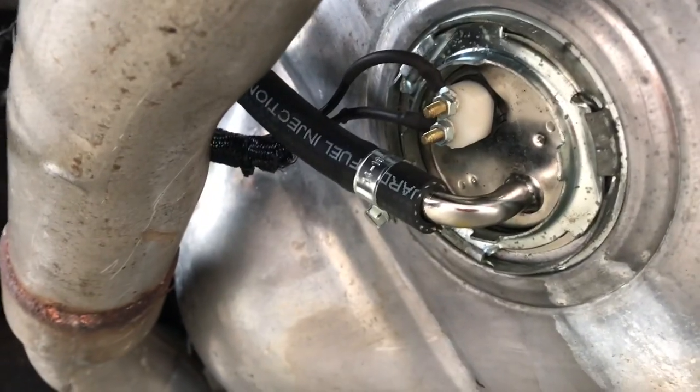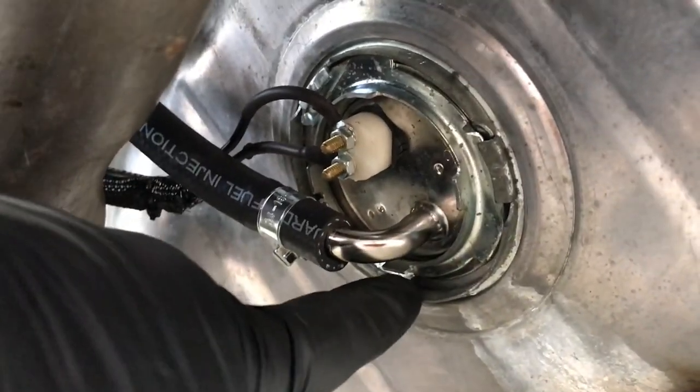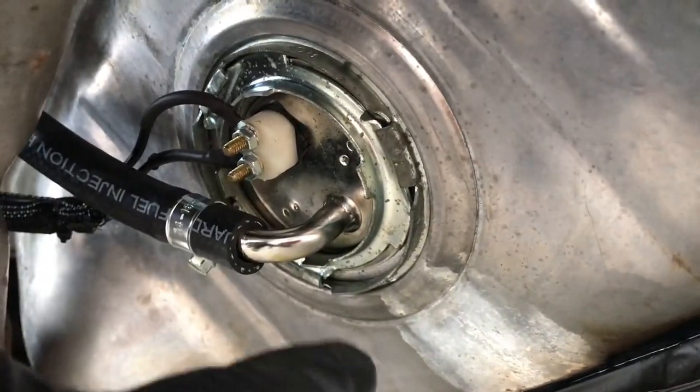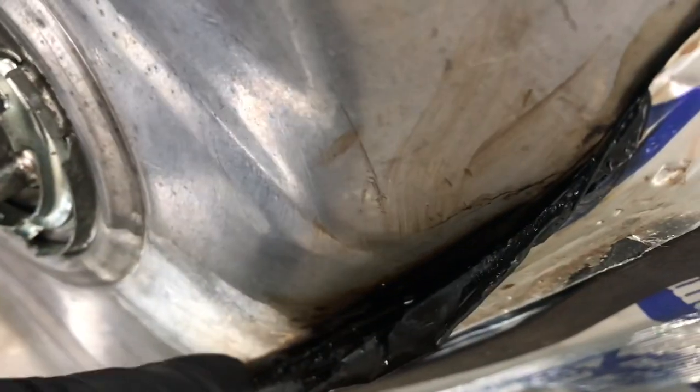If we do a little further investigation right here, the whole system has no leaks whatsoever, but the fuel sending unit locking ring seal — which is the only part I didn't replace after I had taken this thing apart and put it back together a couple times — likes to leak from time to time. You can see some of the gas that's eaten into the fat mat here, see how it's all liquidy. It's dripping from here down into here, it's caused some tarnish — it's just a nasty, stinky problem. Not safe.